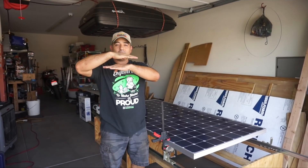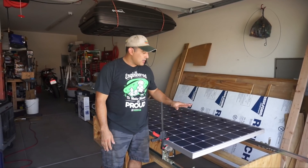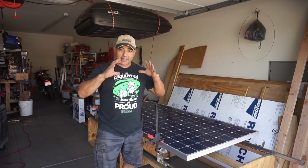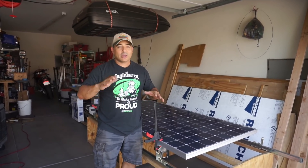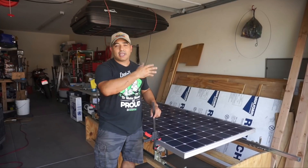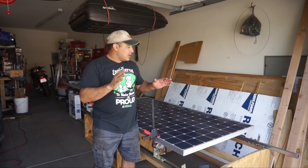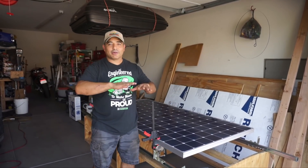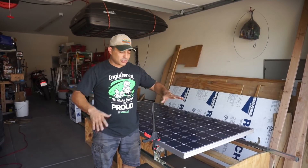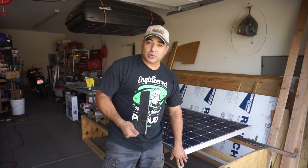For the top design we had originally considered having one panel slide out and then this one tilt up. But in doing that, these panels are so large that we really didn't find a good way to do that where we felt they would be secure and latched enough to withstand the high winds — not only of traveling, but when parked if a gust came through. So we've decided let's not tilt them at all, just leave them completely flat and build a nice simple strong structure that sits above this.